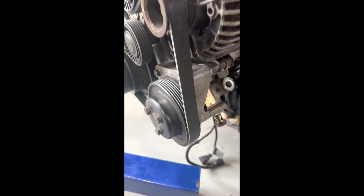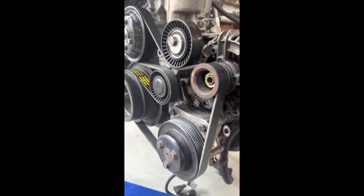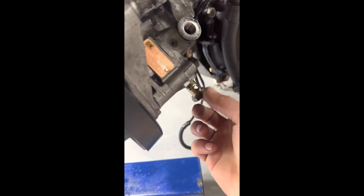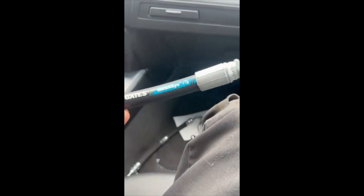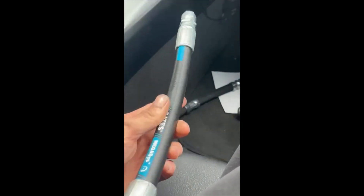Another thing to note is that you lose the bracket for the power steering fluid reservoir, so I'll have to figure that out. Also, the M54 pump uses a threaded insert with an O-ring, whereas the M50 pump uses a banjo with a crush washer. I was hoping the E36 M50 line would work since it has M12 banjo crush washers on both sides, but I ended up having to do a custom power steering line since NAPA and anywhere else didn't have the M12 banjo. So I'm using -6 AN with right-angle banjo-to--6 AN adapters I ordered on Amazon Prime.